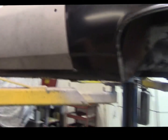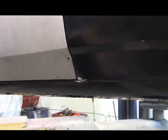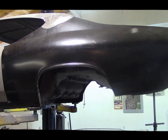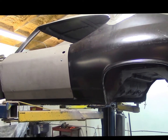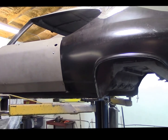We actually replaced all of the rocker panel on this side all the way along — put in a brand new rocker panel. The door is just on here for mock-up to make sure we get the right lines and gaps all the way around. I pre-fit everything. The door is just hanging on there right now, bolted up good and tight, on the striker — it clicks closed really nicely. I wanted to make sure the door had the right gaps before I started welding the rocker and the quarter panel on.